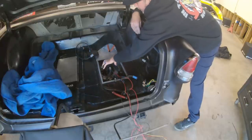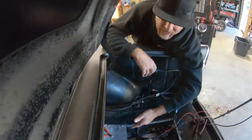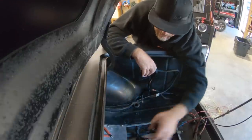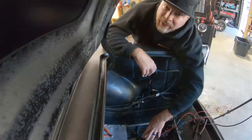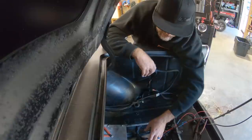This is a Holley fuel cell module. This is meant to replace the cap of a fuel cell. They come in 6, 10, and 12 bolt mounts. Essentially, if you have a fuel cell, you can just take your cap off, bolt this in, make some adjustments to the pickup, add some wires, and you can drop in as much as 2,000 horsepower worth of fuel pump.